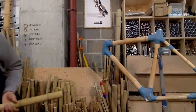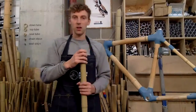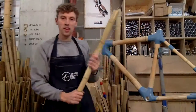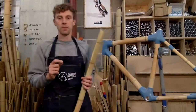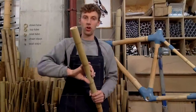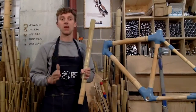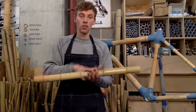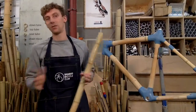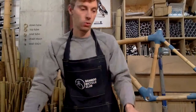If you're picking your seat tube, firstly you want to make sure it fits within your frame. Also think about what you want to fit to the frame — if you're going to fit a front derailleur or bottle attachments, check the diameter and make sure it doesn't exceed what manufacturers recommend, which is normally 34.9 millimeters. If you're not fitting a front derailleur — and I always recommend a one-by system, I think they're great — then you can get away with almost any size you want for the seat tube.